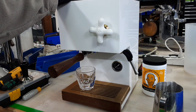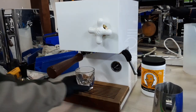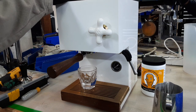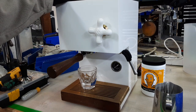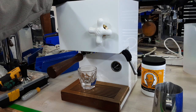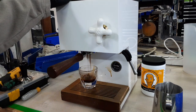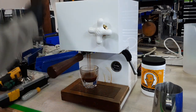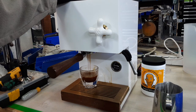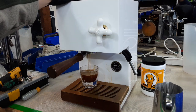Now we're just going to wait for it to warm up and brew a shot. Alrighty, now that we're warmed up. This is the brew button — when it came in it wasn't actually working, so now when we hit it, hear the pump kick on. A few seconds of pre-infusion. Don't worry if it runs a little too fast through the coffee — we used our coarse grind grinder, so when you use your fine grinder it would actually work better. No leaks around the group head because of that new gasket.